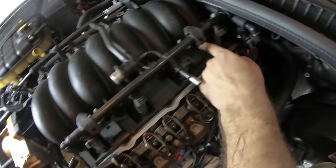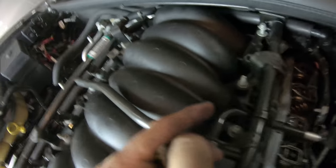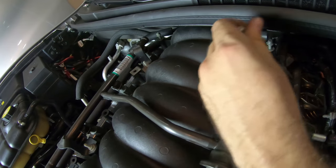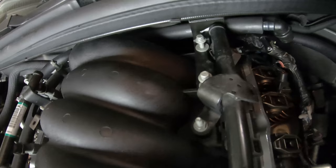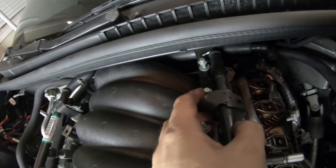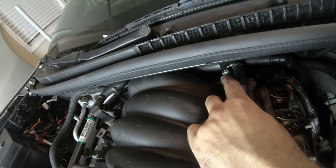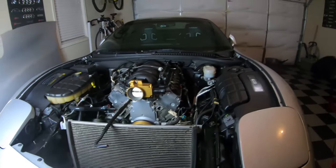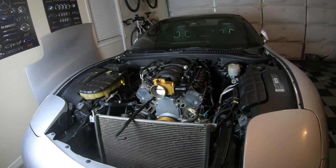On the driver's side, when you get back to the four bolts — the one right before the last one — there's this metal bracket. Slide that over the hole and then slide the bolt through, so it should look something like that right there. The other part of the metal bracket goes back all the way to the last bolt. Now that we have to tighten them down, we're going to torque them to 44 inch-pounds.